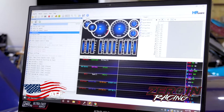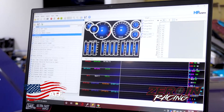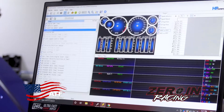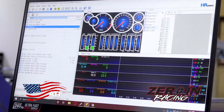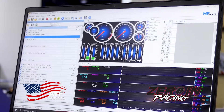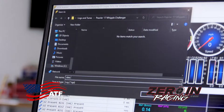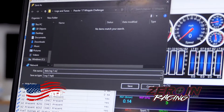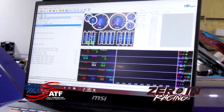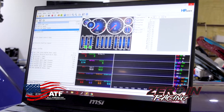If we ask for a data log of the vehicle for tune purposes, you're going to connect to the vehicle, crank it up, and hit 'Start Scanning' and go through it. Generally we'll ask for a couple minutes of drive time, a 3,000 RPM pull, whatever. When you're done, hit 'Stop Scanning,' then come in and do 'Save File As' — just name it something like 'Data Log 1 Mickey V' — and then you can send that to me.